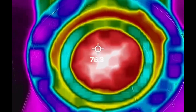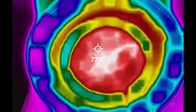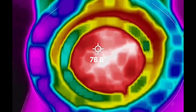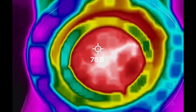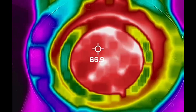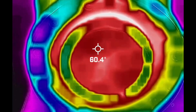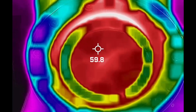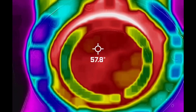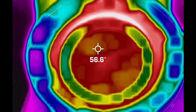Now I pulled another shot. This one got up to temperature a lot faster, but again we're getting to a maximum of almost 80°C. The differential between this and the coffee I'm going to put in is about 60°C, so you're going to lose roughly half that temperature to the coffee — which is why the group head really needs to be hot. Most E61s and the Decent Espresso machines have very hot group heads, and this is really the main challenge for this machine.